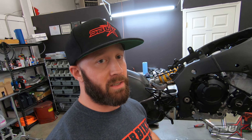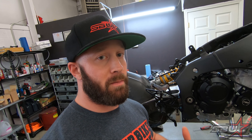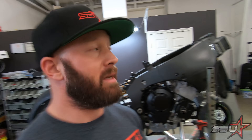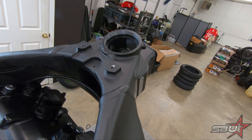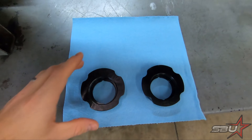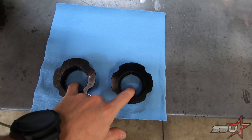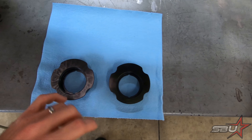One of the key things with a proper superbike compared to a super stock bike — especially under MotoAmerica's Stock 1000 rules — is that we have a lot more chassis adjustability. Specifically we're talking about steering head angle and offset. With a Kawasaki you can actually buy directly from Kawasaki these steering head cups, which essentially control the placement of the steering stem in the headstock. We've gotten ours completely removed so it's just an open frame. These different kinds of cups allow you to change the offset of the stem relative to the center of the hole, or the angle.